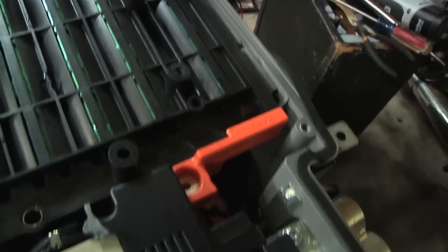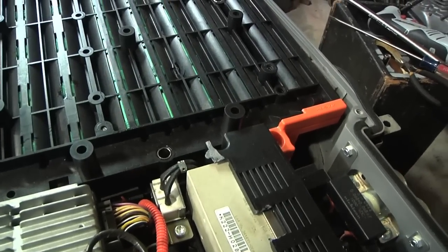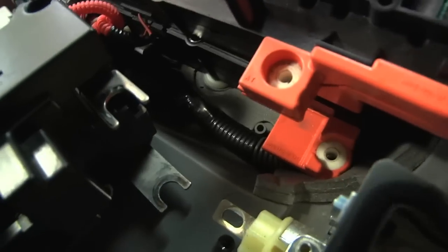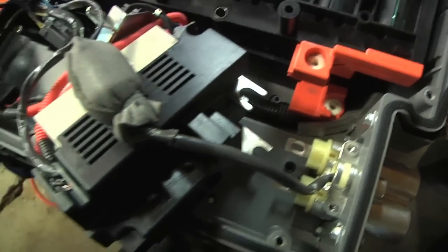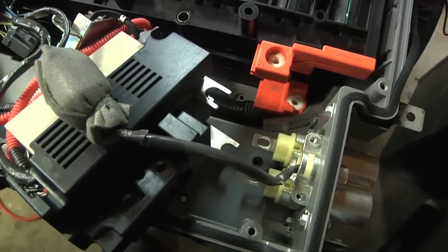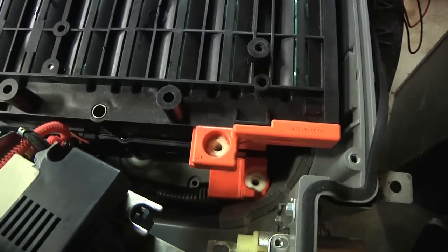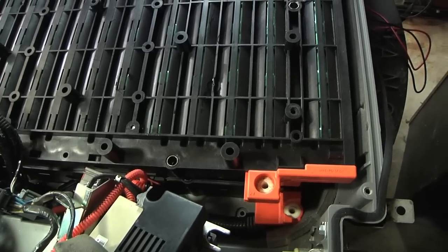I got that loosened up, and then on the other end I have to get the main contactor disconnected, so I had to find all the screws holding that in. After that I should be able to get the top half of the cells out. The main contactor is now loose — you can see the two power connections lined up with the two halves of the battery pack. It's a bit of a trick because I don't have an exploded diagram, so I just have to take out all the bolts and wiggle to see which way things go. Main contactor disconnected, service disconnect disconnected — getting closer to getting that top section of pack out.